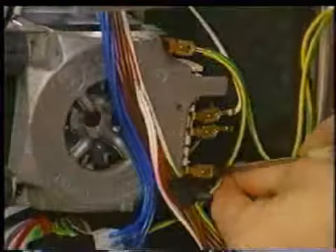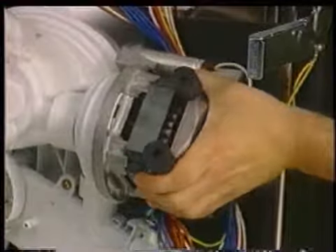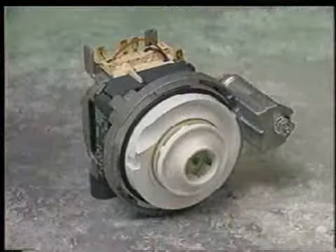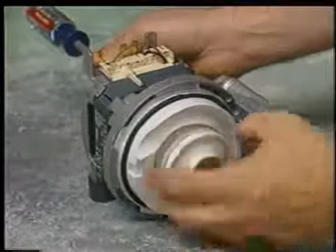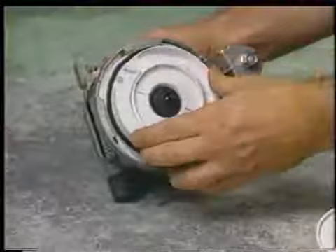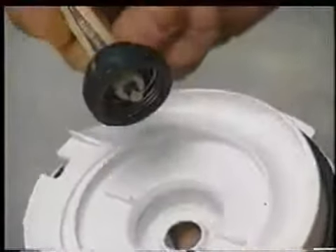To remove the circulation motor and pump assembly, disconnect the four wire leads, then grasp the motor and turn clockwise a quarter turn until the motor stops. Now remove the motor from the front pump housing. The front pump housing will remain in place when the motor is removed. With the motor removed from the unit, separate the motor from the rear pump housing by first removing the impeller — place a block in the rear of the motor and turn the impeller counterclockwise. Now remove the rear pump housing by turning it clockwise and lifting off. Located on the rear pump housing is the pump seal, which is a press fit and can be easily removed and then pressed back into place.